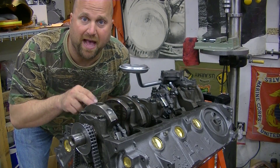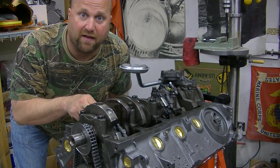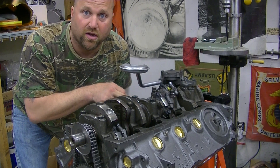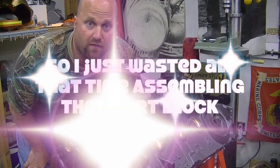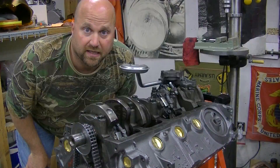When the machine shop did the balance or the blueprinting of this, they should have made sure that the crankshaft connecting rods — which they even had numbered for each cylinder — were within measurement specs of what the crankshaft journal width was. We finally talked with the machine shop yesterday, and Bart is working with me over there. He got me another 340 crank and is re-blueprinting and re-balancing everything that needs to be done.